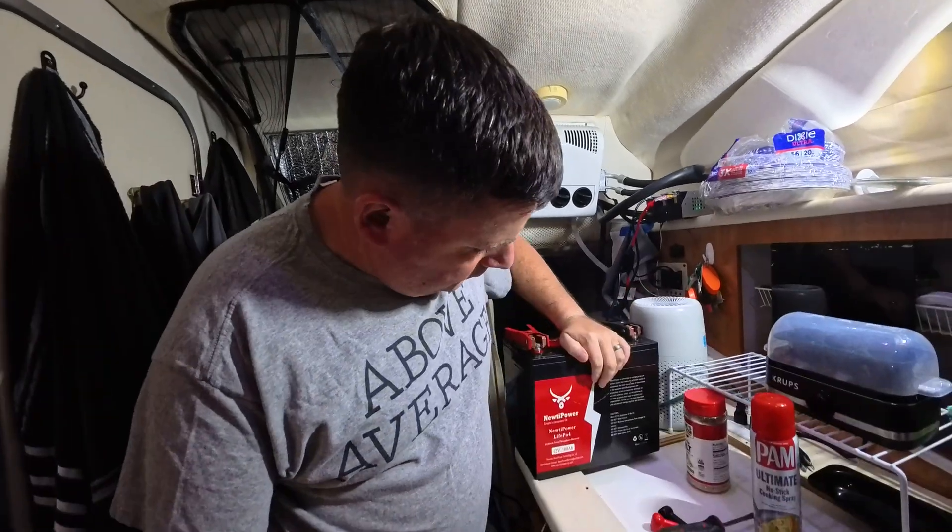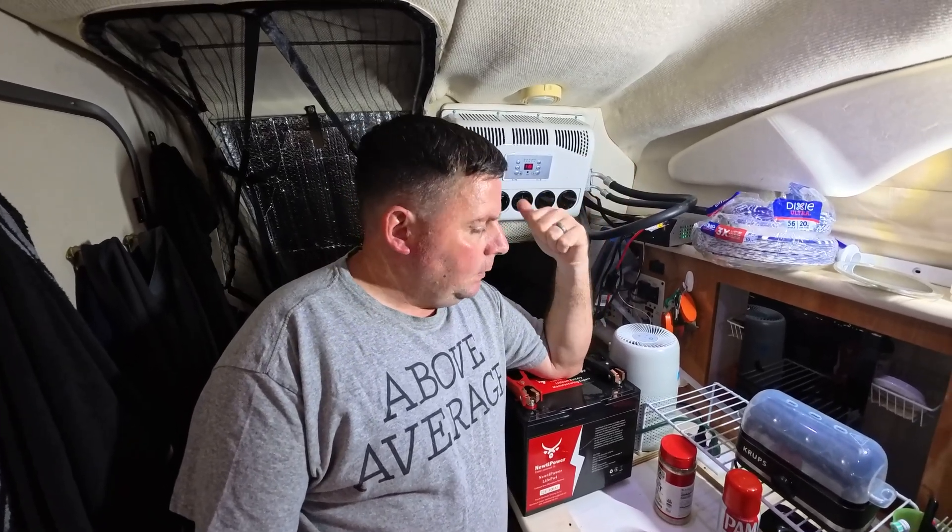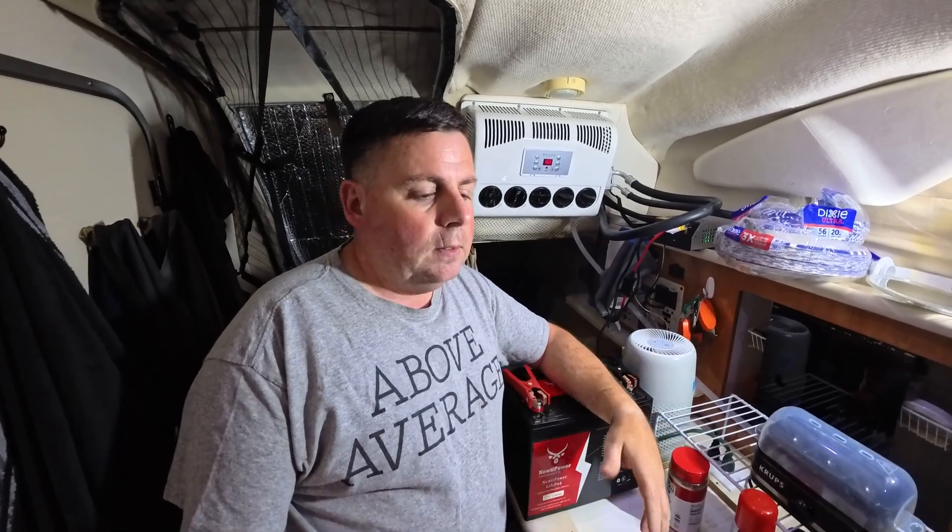Final results are in. This NewT Power battery — the first test went poorly because the battery wasn't fully charged; you need to discharge and then properly charge it. After a proper 100% charge, I brought the boat down from 94 degrees into the 70s and then ran on eco — I got three hours out of it. This time, I pre-cooled to 70 degrees using the converter, then ran on eco. It ran for five hours — from 5:15 PM until 10:15 PM when it hit zero.